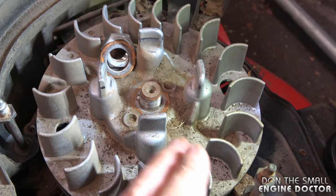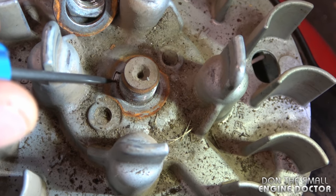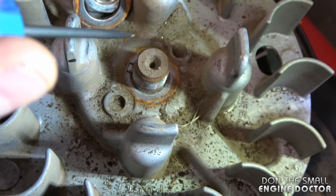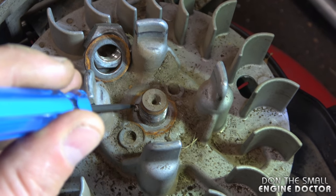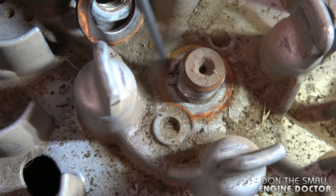The third most common reason why mowers come in my shop vibrating is because of a sheared flywheel key. This will happen if you hit a blunt object — kind of like getting a bent crankshaft or a bent blade, it's all related — and it affects how the engine runs, causing your machine to vibrate or run rough. Every lawnmower has a key between the flywheel and the crankshaft. It's a small key that goes in the keyway on the crankshaft to connect the flywheel to the crankshaft, and it's kind of a sacrificial part — so if you hit something hard, the flywheel key will shear.